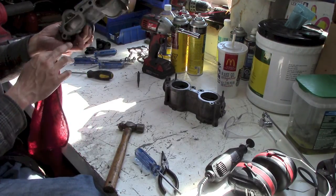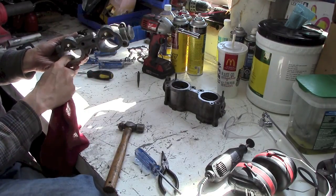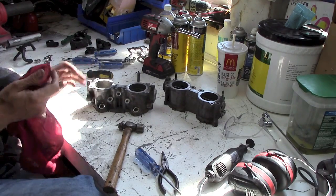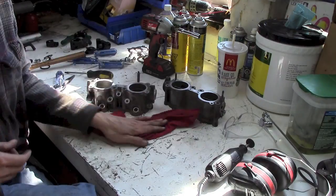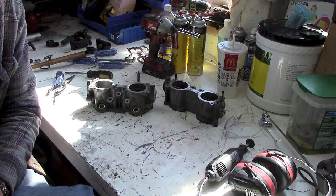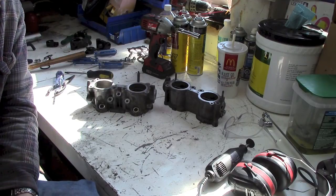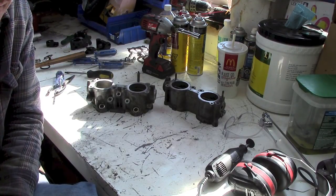I don't know why. Oh, I think that's for when the motor closes the butterflies, it still gives a little bit of a spot for the air to get through for idle purposes, kind of like an idle circuit. Then when the butterflies open up, it goes through the main bore. But I need to cut those out and smooth it all in and make the plates. So like I say, the next video will be cutting that stuff out.